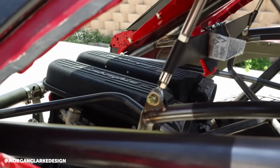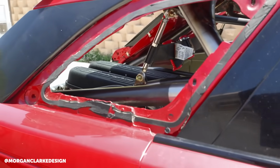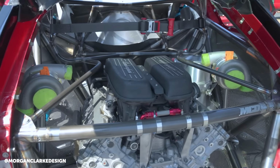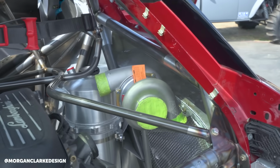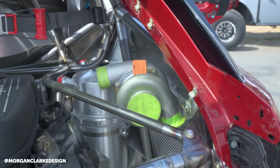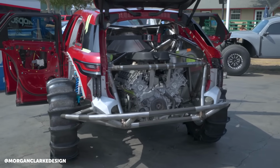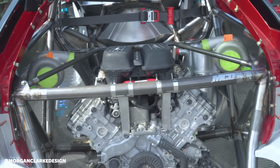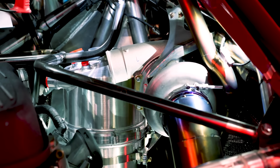Okay, so twin turbos on a Lamborghini V10. I mean, there's plenty of people drag racing these with upwards of 2,000 wheel horsepower and just about anything in between. What sort of power level are you targeting with this? It's a stage 3 underground racing motor, so it's fully built. It came out of a Huracan, so it's already good for the power. It's twin 68s. Precision said that this is 2,000 wheel all day. So that's the plan.